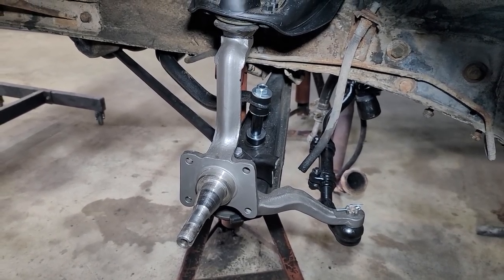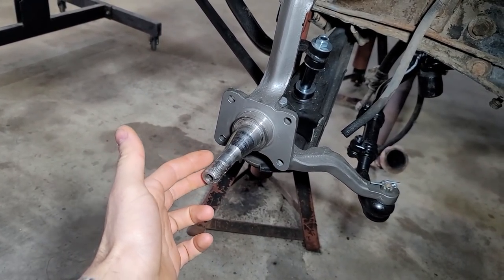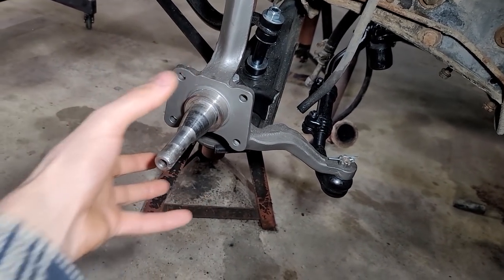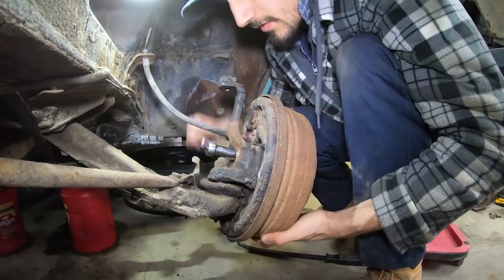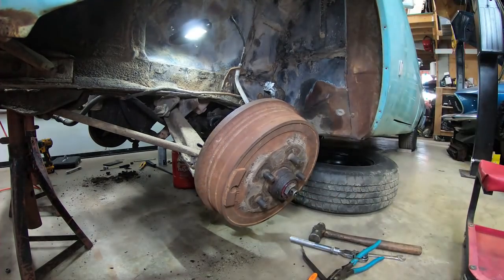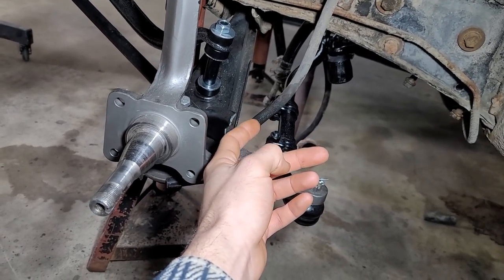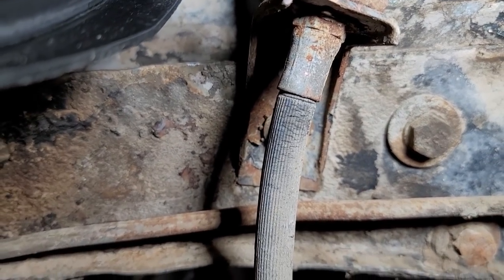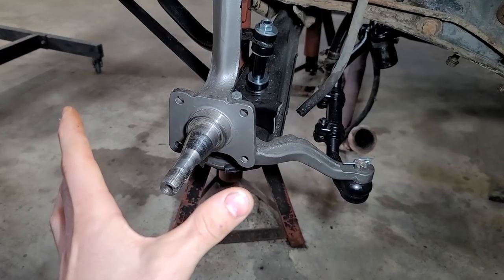Since we already stripped the original drum brakes off, it's simply taking the main nut, washer, bearing retainers, and removing these four nuts from the backside, and that whole drum brake assembly comes off. It's really not necessary to take apart the entirety of the drum brake assembly — taking the shoes off and all that. Just leave it all attached and slide that whole assembly off. You'll probably have to tap it a few times. You also have to cut the original brake lines, which is no big deal because we're replacing those anyway. Majority of the time they're all checked and cracked, so give her a snip and slide that whole assembly off.